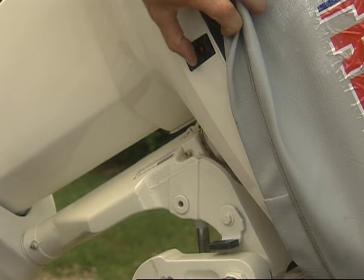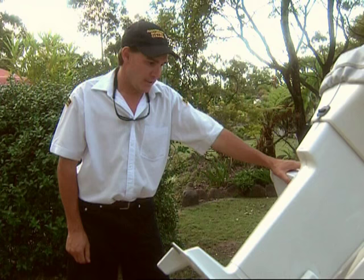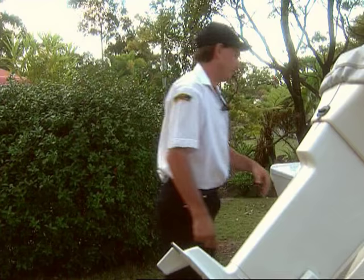What I'm going to do now is to trim up the engine, put down this little support arm and trim the weight of the engine back down onto that. What that does is it takes the weight off the hydraulics for towing. So that's the boat and the trailer looking good, let's hook it up to the car.